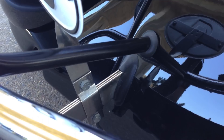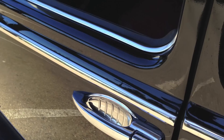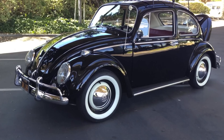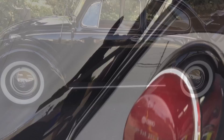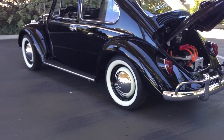After we install the electric components, we drive it for a couple of weeks every day — about four or five hundred miles — just to make sure everything works and all the concerns get corrected. I really love using LED bulbs throughout this entire car — they're super visible, super bright. Keeping you visible is very important on this car. For added visibility, we include an electric-exclusive hidden third brake lamp, and these super stealthy backup lights hidden inside the Peashooter exhaust — I just love that. The car sits at its stock ride height, and it comes with freshly powder-coated two-tone smoothie rims and white wall radials. And yes, white walls were a dealer option for the Beetle back in the 60s.